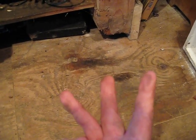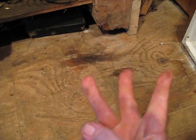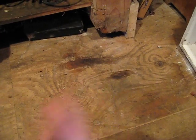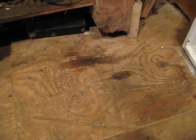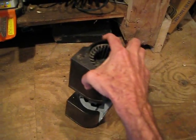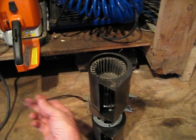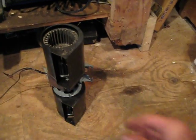There's three of each. There's three motors, three wires, and three switches, and that's about all that's to the stove. The three motors are the convection blower. The convection blower is a squirrel cage fan that blows the heat out of the stove. It's just 110 current that runs that, as it is in all the motors.